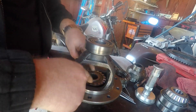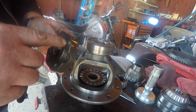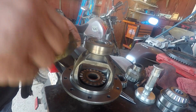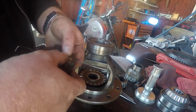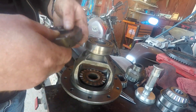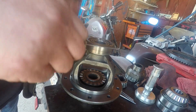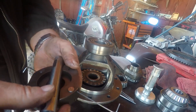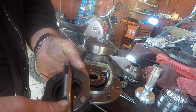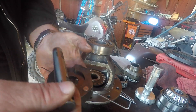So we're going to put this — I think it's the driver. You have your pins in here with a spring behind it. It's got a little relief cut in there so you can push it back and then hold it in place. They come kind of preloaded, but the pins are real short. Our cross pin is going to go in here and you want this large flat surface to ride on that cross pin. If you put this the other way around, that's no bueno. You also need relief — your axle shaft, I think, fits in that little pocket there. So this is the way that bit needs to go.